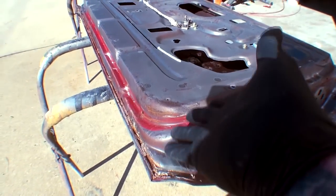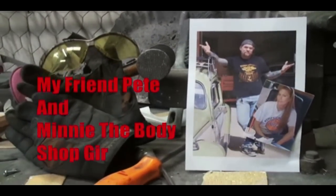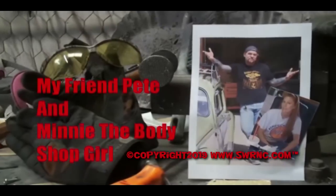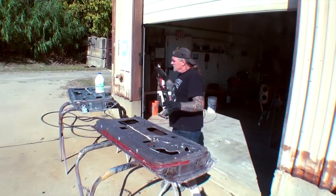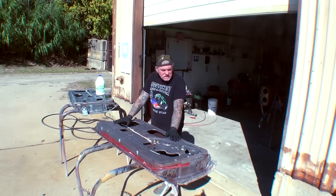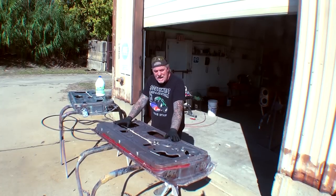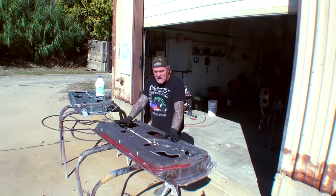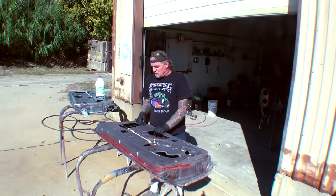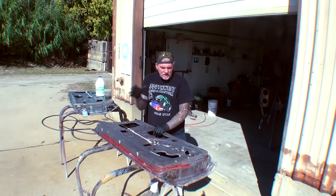Welcome to DIY Automotive School with my friend Pete and Minnie the Body Shop Girl — it's everything you need to know about cars and more. We did have the whole car soda-blasted, and once I had it soda-blasted, I went straight to the car wash and washed as much of the soda off as I could, but there's still a residue of soda on it. Besides that, we've got surface rust that we need to remove. And the way we're going to do that is not with some hokey-pokey chemical you can buy over the counter — I'm going to show you exactly what to use.